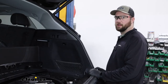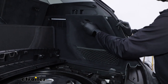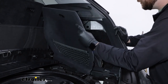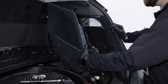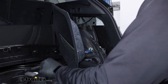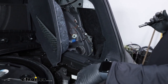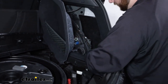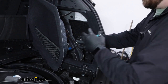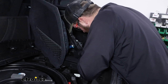Just pull that out like that. Now we're going to have to get behind each of our side panels. You just turn this little knob, lift that panel up and out of the way. This one is held on with a 12 volt plug back here, so we'll just set this one off. The driver's side one you can completely remove. The hole you're looking for is exactly like these other two — it's just going to be back here. You can feel back, it's right down here. We'll remove the 10 millimeter nut just like we did before.